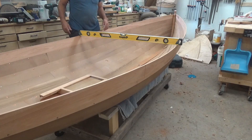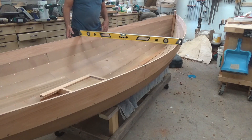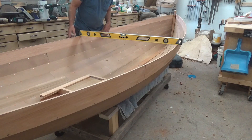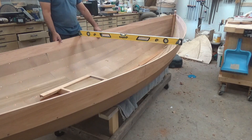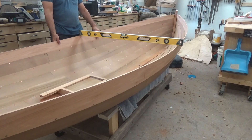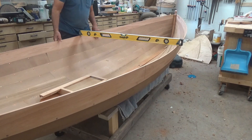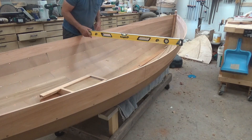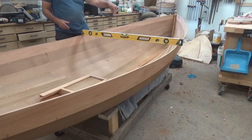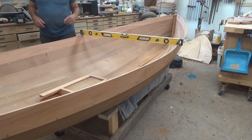To install this and make sure the box is perfectly vertical and on the centerline, I need to level up the boat. It's just sitting in a stand right now, so I can slide it to starboard a little bit and get that bubble lined up on center — which it is perfectly right now. Then I can use the level down and I'll put some bracing in.